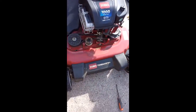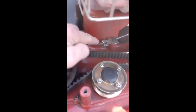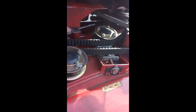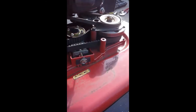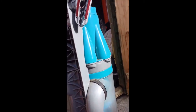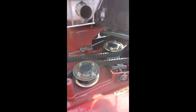That bracket is easily undone with the bolt — at this stage you can pull it out. Now we're down to the front box area. With the covers off you can see the blade cable going onto this clamp, which is important because that's what adjusts the tension. Taking the cover off is quite easy — just four bolts, pretty straightforward. Then I hoovered out the bits with my old Dyson, which I only use for this sort of work, not for the house. So now I'll undo that clamp and see how the cable hooks on underneath.